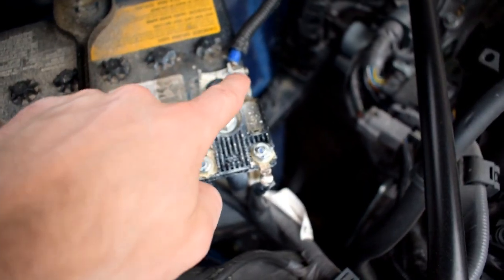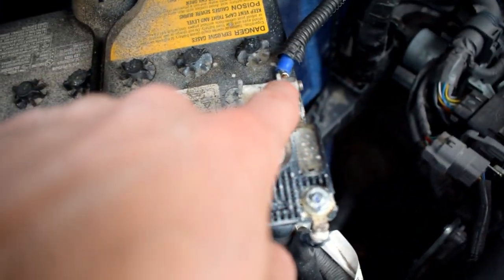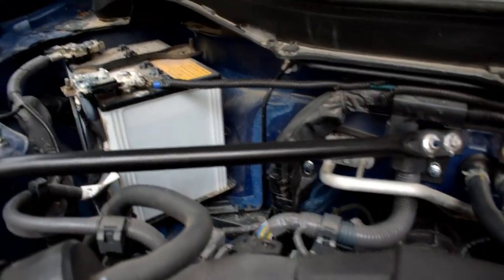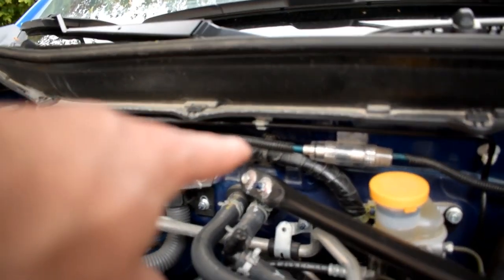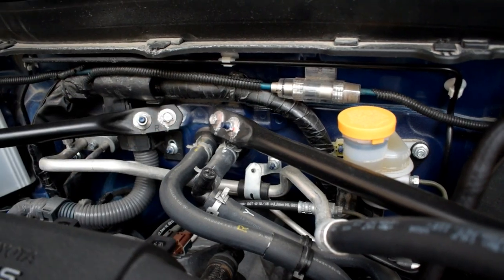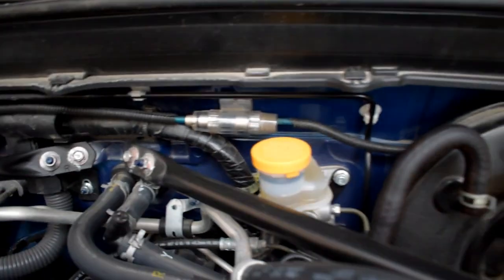The first thing I did was put the power wire to the battery. I just attached it right here on the outside of the positive — it's got one of these clamp things already on both sides and I just tapped into it on the outside. My wire already had this little black wire protector on it, but if yours doesn't you should probably get some just to keep it cleaner. Then I literally just ran mine across and two-way taped it right there.